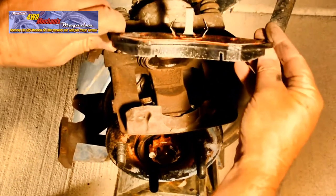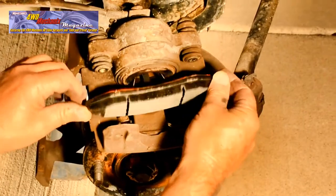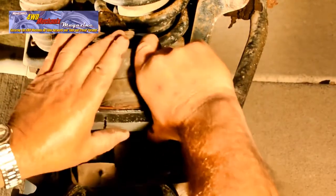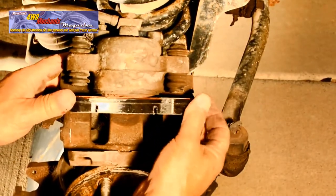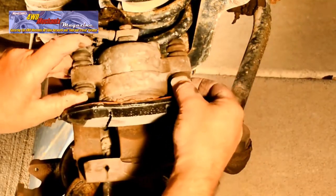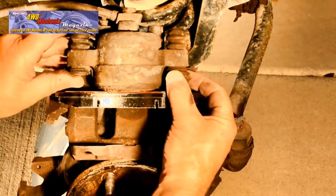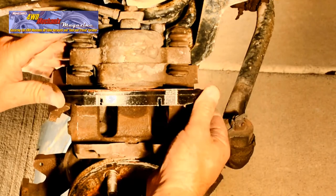The brake anti-squeal compound is completely dry at this point. Center up the three tensioning springs on the inner pad. Push the springs into the bore of the caliper piston and make sure that the pad is moving freely. Make sure these bushing sleeves move freely and that the boots are undamaged. Move the bushings away from the brake pad to provide enough clearance for the caliper to fit over the bracket.